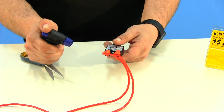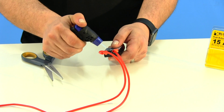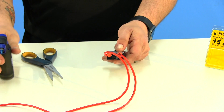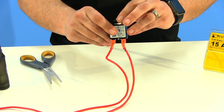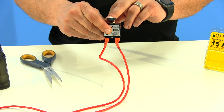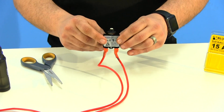Take your heat source and wave it around the heat shrink — don't focus it in one area or you'll melt the wire or the heat shrink itself. Once done, let it cool down and don't tug on the wires yet. If the breaker's nut is all the way up, take it all the way down and follow with the top. That there is your mini fuse breaker. It can be used in any application — door switches, thermal fuses, regular fuses — but it's not to be left on the unit. When you leave the home, take the fuse breaker with you; don't leave anything bypassed for the customer. Just correct the issue with the proper parts.